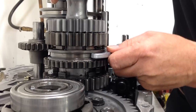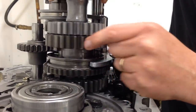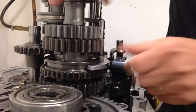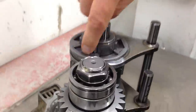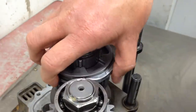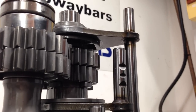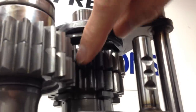When you change gears, it goes from one direction to the other and it engages that gear, which is then connected to the primary shaft, which is then connected by the dog ring and locks them in together depending on which gear you want to choose. You'll see on the top of the box here the reverse side of this dog ring, which is the slot where the dog fits down inside — which is on the other side underneath. If you look underneath, you'll see there's another dog, and when this dog ring slides down, it slides over this dog and that's what provides the drive between that gear, the dog ring, and the sliding part on the shaft.